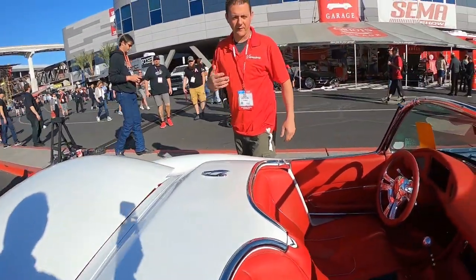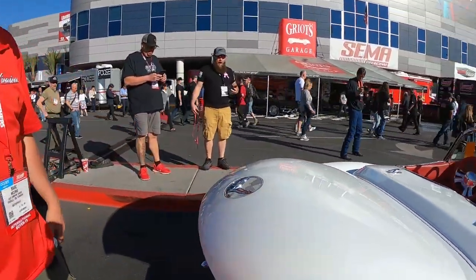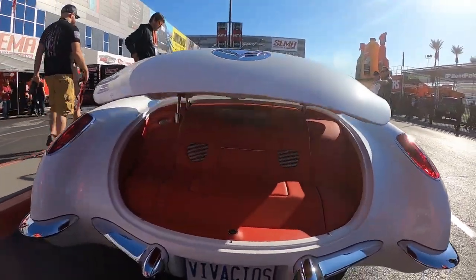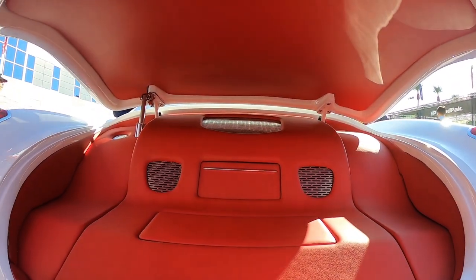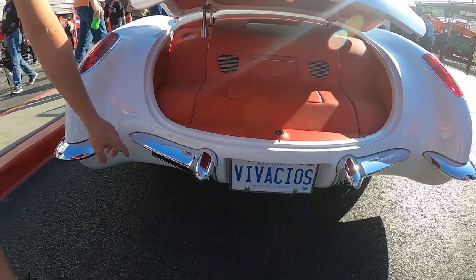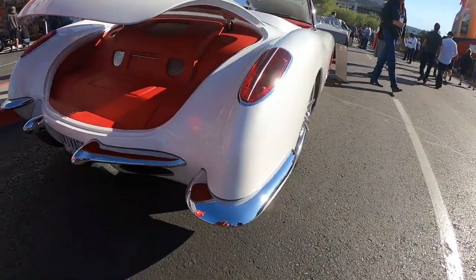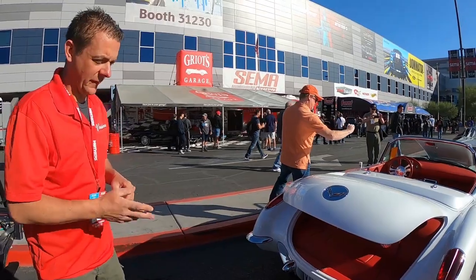Since we went with the LT4, we wanted to carry that theme on. If you look at the back here, we also did a custom emblem that incorporates that. The trunk was actually CNC scanned as well, done with the exact profile of the car. I put an electromagnet in the trunk too, so it latches down once you hit power. The rear bumpers are from a '57 — we shortened them and welded them together so they're all one piece. The back bumpers were made from a wooden buck, which we then CNC scanned, and they're billet aluminum — we had them pro-plated.